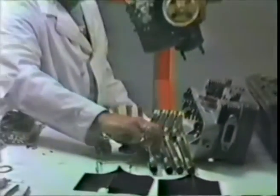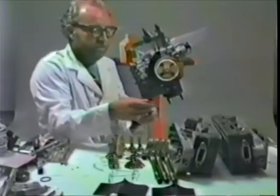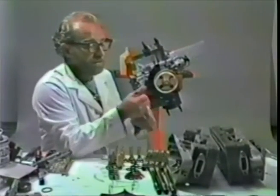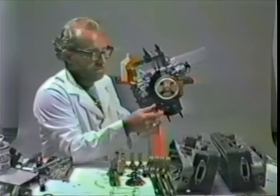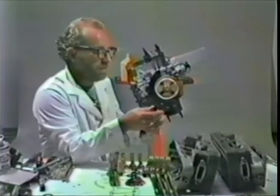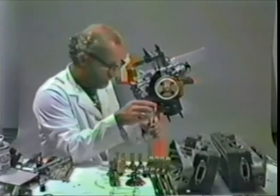So what we'll do now is show you how to put the seals on the pushrod tubes. Now since we're putting shims under the cylinders, it's usually best to wiggle and pull on the convolutions here of the pushrod tube, and the big end with the extension gives you more meat to grab onto. We want to enlarge them a little bit so they can compress and therefore seal right.